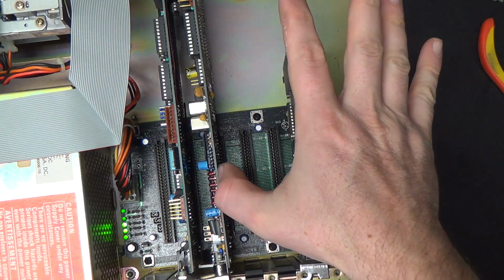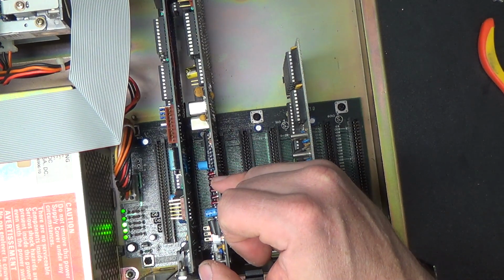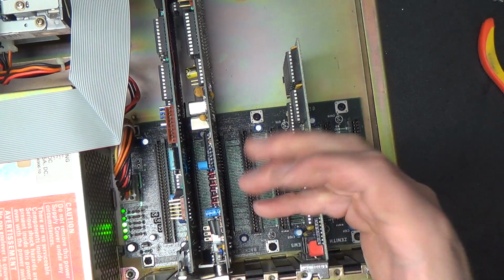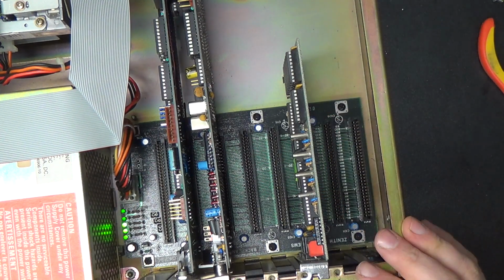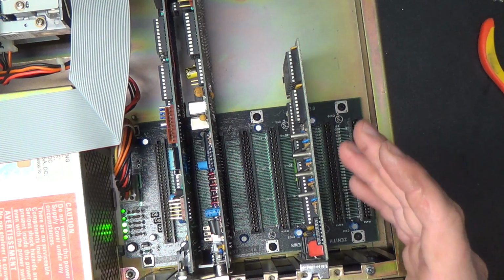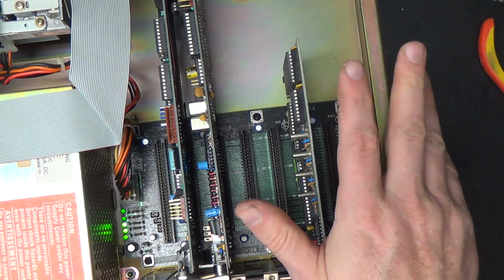But here's something else interesting. Up here on the CPU card, it has a bunch of activity LEDs for the CPU, the ROM, the RAM, the interrupts, the disks, and I guess the ready line, because it's lit right now and it's active low to halt the CPU for DMA and stuff. Am I thinking of the right line? Maybe I'm full of it. I can't remember. Sorry if I'm wrong. Anyway, that's pretty neat. This is a really cool old computer, guys.